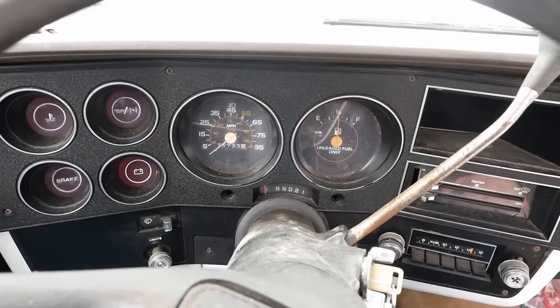Well, folks, we do it right because we do it twice. Wouldn't be a proper carburetor rebuild unless we did it at least twice. My theory was that there was something plugging up one of these low-speed passages, and I think that would explain the stumble off of idle. But it certainly doesn't explain why it got stuck on high idle and why the idle speed just isn't repeatable. So talking to Mortsky last night, it kind of seems like the only explanation is the play in the throttle shaft. So it's quite a bit.